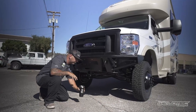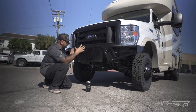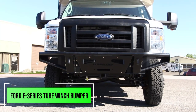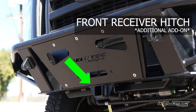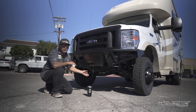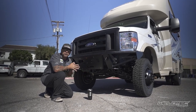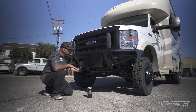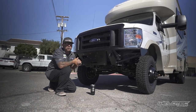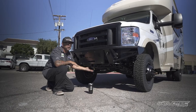I'm going to come up to the front of this thing — I got to put my awesome Weldtech Designs mug down to use both hands to tell you how awesome this bumper looks. This is going to be our tube winch bumper, but what we did different on this is it's actually going to have the receiver hitch. If you want to add a front receiver hitch to your bumper, or maybe you already have one of our tube winch bumpers, you can still add it — it is a direct bolt-on to the bottom of this bumper. However, this customer opted in for the heavy duty version, so it's completely welded onto the base structure of the bottom, making it even stronger. Typically we say if you're going to be carrying more than 300 pounds on there, we recommend a welded-on structure.